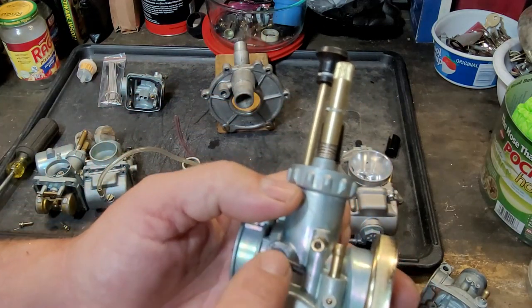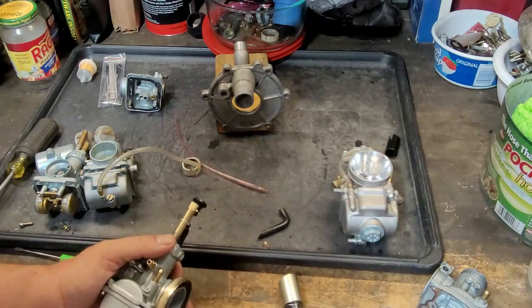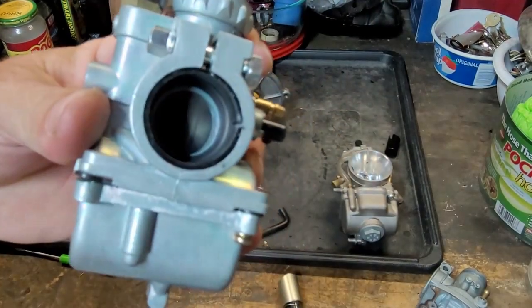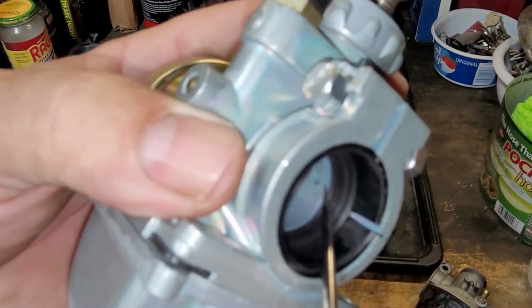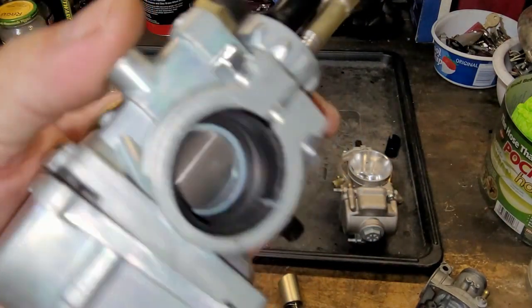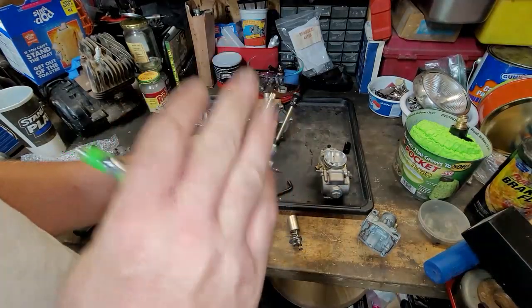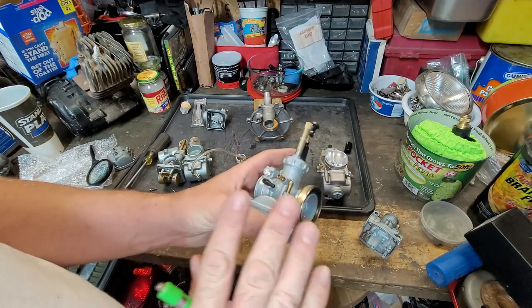This third one has to be plugged — you have to put a vacuum cap on it. A vacuum cap is a little rubber cap that slides over it. Here is why: this one right here will suck air. If you look right up in here, you can see that hole — that hole is connected to here and it will suck air and cause it to overspeed, a lean condition. It won't calm down when you rev up; it'll just keep racing and racing and racing. So you definitely need to plug it with a vacuum cap.